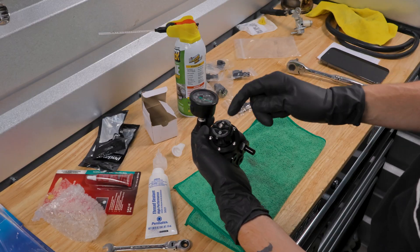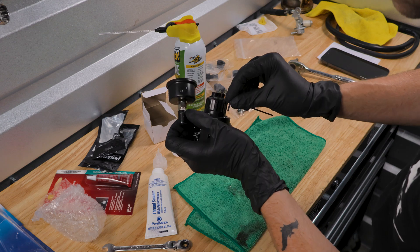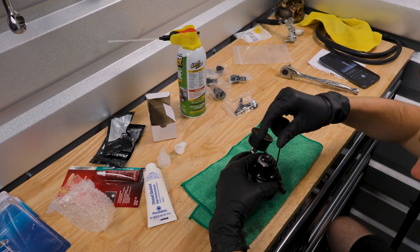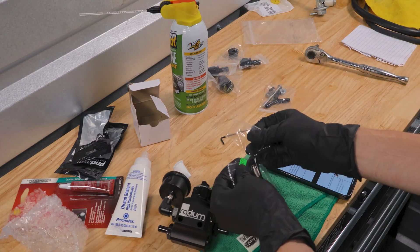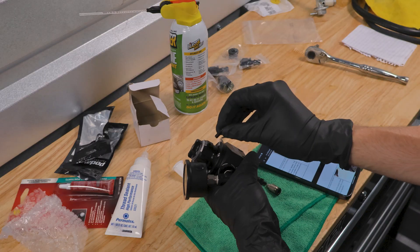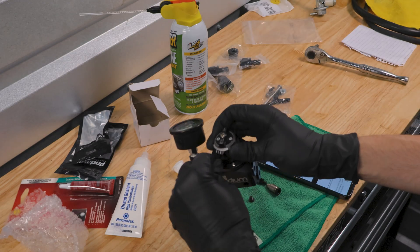The last thing I'm going to do is move the vacuum reference point over to the other side. We're going to need a 3/32nds of an inch Allen key — this thing is so small and it's kind of hard to get in there. Last thing is to open this pack up — there's going to be a little nipple bleeder, kind of like a brake caliper bleeder, that we're going to thread through for our vacuum reference. This just gets hand tightened until the threads are gone, and that is where our vacuum line is going to be going.